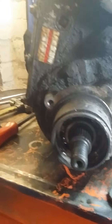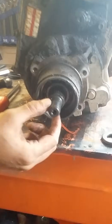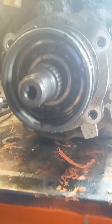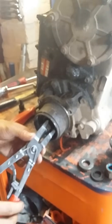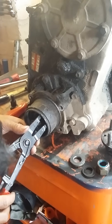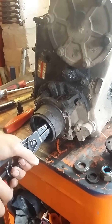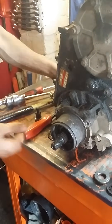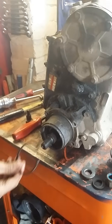If you fold up the seal it's just a bit easier. Then in here you've got an internal circlip, so you'll want decent circlip pliers. Ratchet ones are better because it saves you pinging them off in your face. Once you've got that circlip out...